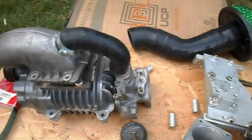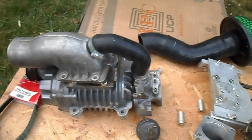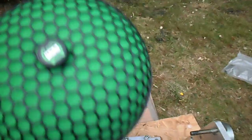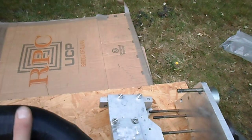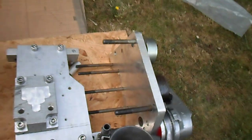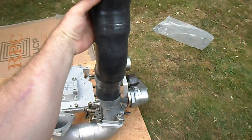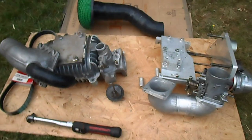M62s are usually used on two-litre engines, and this is a 2.8 litre. The M90 came off a four litre Jag so it should be good - it shouldn't run out of breath too badly. For the intake I'm using a genuine HKS mushroom filter with some aluminium joiners to connect it all up with some silicon hose that I measured, cut, and measured again. That will go on there like so and then fit in the car.